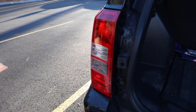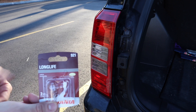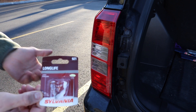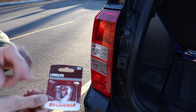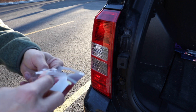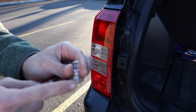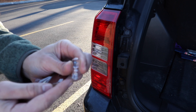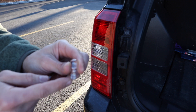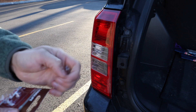As far as what you'll actually need to replace the bulb — first off, if the bulb's actually out, you're going to need new bulbs to replace it. You could just go to an AutoZone, Advanced Auto, any auto parts store, and you'll get the Sylvania. It's going to be number 921. The bulbs are going to be these clear bulbs with a clear insert on the bottom. There's actually going to be no attachment here. Sometimes they give you the ones with the attachments, which are wrong, but you're going to need this actual clear bulb.